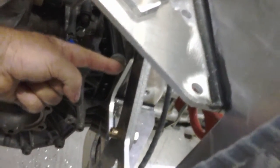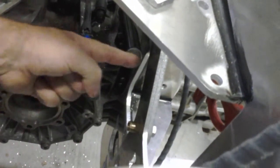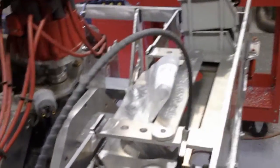Got to looking at this shifter. I said, well, wait a minute. Come back over here and look down in here. See, look right down in here. This is your shifter arm for the forward and back. And it's always been a problem that those lines run right here in the way of the hydraulic line for your slave cylinder. I said, what if we move this arm out this way, stop it right here, and pull from up here? Then what if this cable right here, instead of having a pitman arm, just pulled in and out?